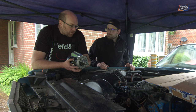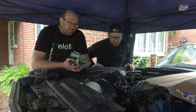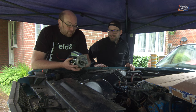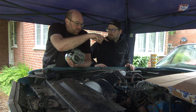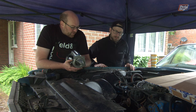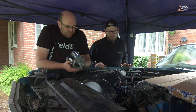We need to think about getting spark plugs back in the right order - that's fairly crucial. Ford cylinder one is on the right, apparently - I would have to look that up. One, two, three, four, five, six, seven, eight - which is apparently not what anybody else does. All other manufacturers go one through eight the other way, so one and five are opposite each other. But on this, one and eight are still at opposite corners, despite being a completely different cylinder numbering system. On American cars this being the driver's side, one is usually driver's side - except Ford.